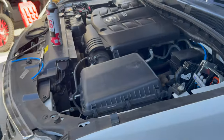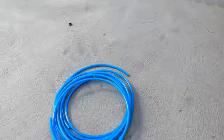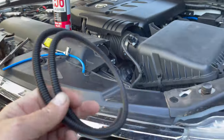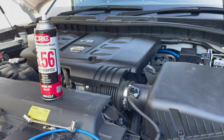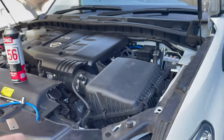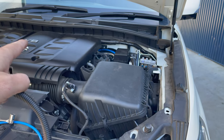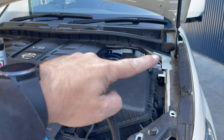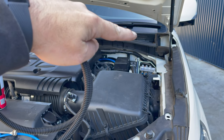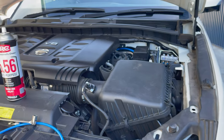I hope that was as simple and straightforward as it could be. Still got heaps of tube left over if I ever need it. I do have a little bit of black conduit here — might be close enough. Everything's all up along the chassis rail. Basically we've got our front diff that comes up behind the air box and goes straight to the bracket. Gearbox and transfer case start here and come straight across to the bracket. The rear diff way back here comes down sideways out the way, making sure not to rub past anything, cable tied all the way along the chassis rail and then up into the bracket. Pretty straightforward.